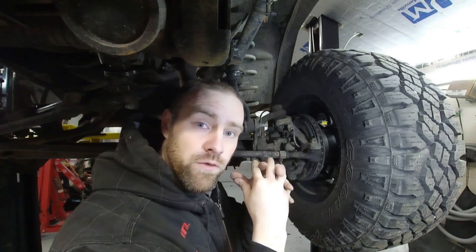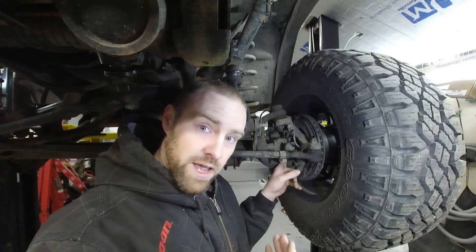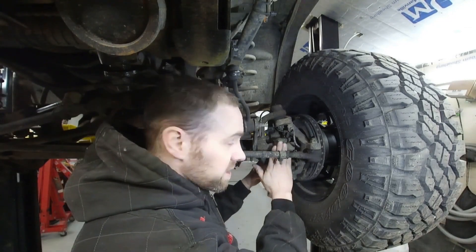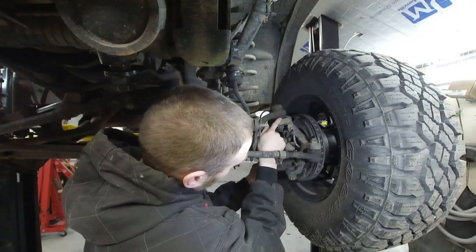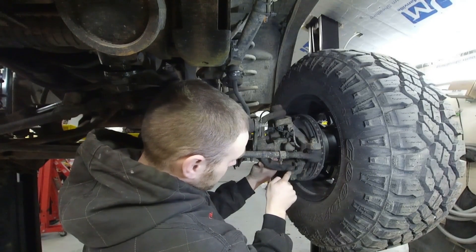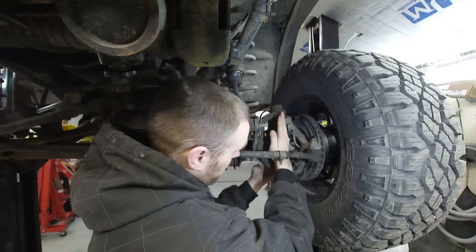That's why newer cars and trucks use what's called a CV joint, which has several different balls and sockets that all slide and move within each other. It has a lot more degree of range before any kind of binding happens, and they work a lot better. This U-joint design is great for minimal angle movements because it's very strong, but it's pretty poor for something like a steering area where you have a lot of degree of movement. You can see where the joints are located for the ball joint — that's the part that swivels — and it's very important where they locate that on the vehicle because they can get just a little bit more degree of turn before bind, because of the way it's all lined up.